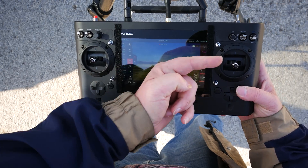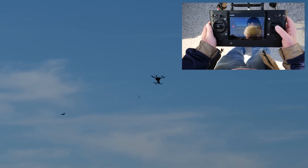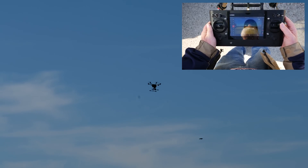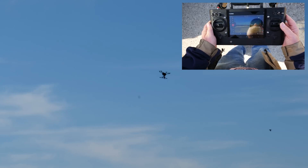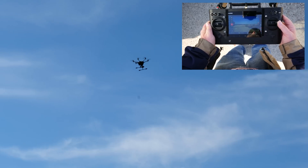I like using the green arrow as a way to bring my drone back safely in angle mode, but it has the same limitation as hitting the home switch. If you lose your GPS connection, you won't have that arrow to help you navigate. The third way to return your aircraft is a reliable method for returning your drone whether or not you have GPS signal.